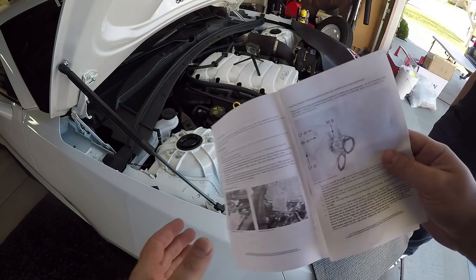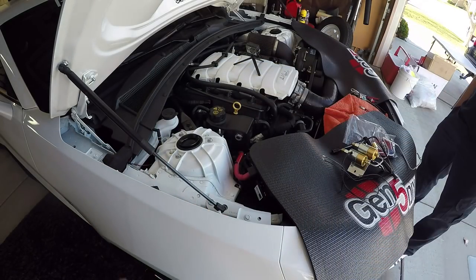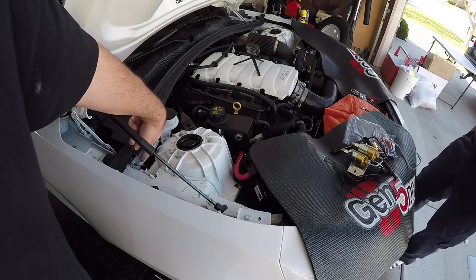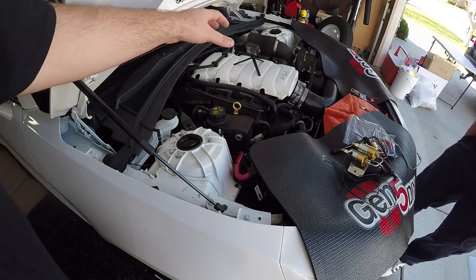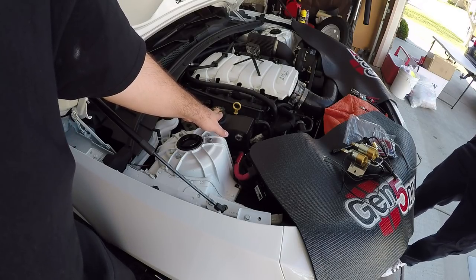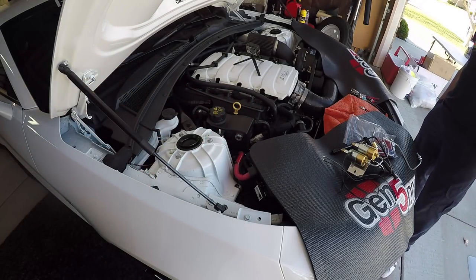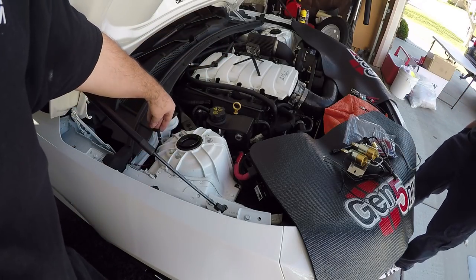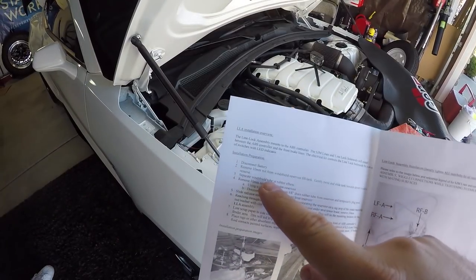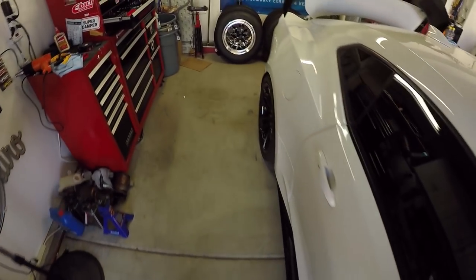So, one other car previously. There are a few things you've got to do. Most of the work is happening over here — we're going to be removing your washer fluid setup. This literally just stabs into the reservoir sitting in this area right here. We will be pulling out the overflow. Step one: disconnect your battery. Your battery is in your trunk if you didn't know — I've shown this on a few other videos. Passenger backside, disconnect your negative terminal from battery.